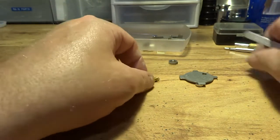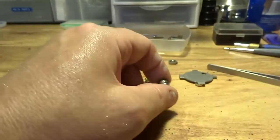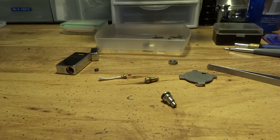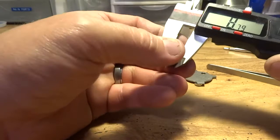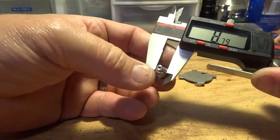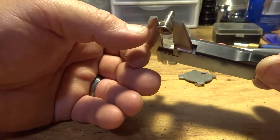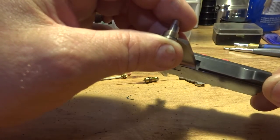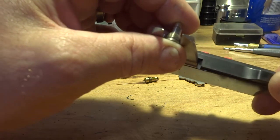And as far as O-rings for this, I can't remember the size on it. Let me see. Got my calipers here. I'm gonna guess it's probably around 9, maybe 9 millimeter. Yeah, 8 to 9. I just go 8 millimeter, actually a little smaller than that. Maybe, yeah, 8 exterior would be plenty.